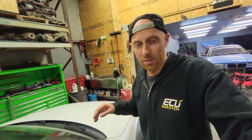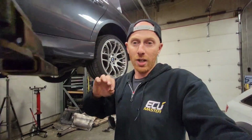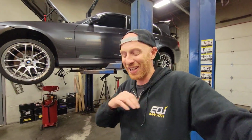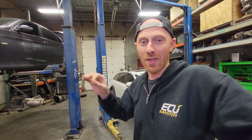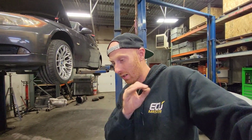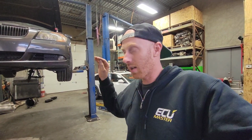But it's nice to have a parts washer. You get the parts really clean and hot. The cylinder head came out really good. We did a vacuum check on the cylinder head earlier, and I picked out a good one, because not only is the head straight, we checked it for flat, and we did a vacuum check, and everything is perfect. So now that the head's clean, I'm really excited. I think it's gonna come together and be the right combo. The bottom end is really good, the head's really good. It's so flat, I always send the head to be cut, but this one's so good, I'm just gonna clean it really good. Copper spray, new gasket, head studs, boom, ready to go.